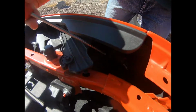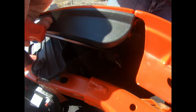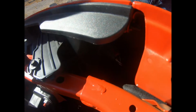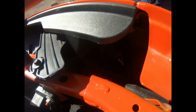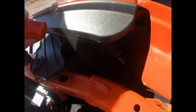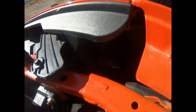All right, so step one is getting the headlights unplugged. You'll see on the headlight connector that there's a red tab. Just use a long screwdriver or something and slide that back. If it goes flying, don't worry about it. It's not necessarily needed for reassembly. As long as you put it back together and it clicks, you're okay. Now what we've got to do is unplug that. Because my hands are big and don't fit in there the best, I will just push down on the tab and slide it right out. Comes right off, super simple.